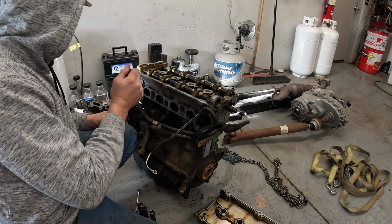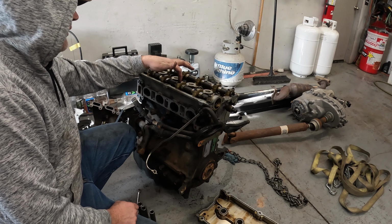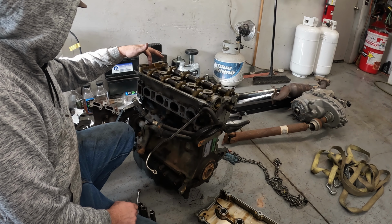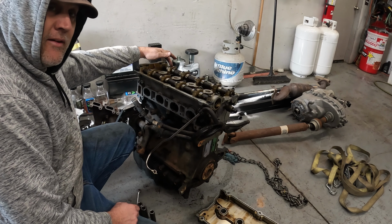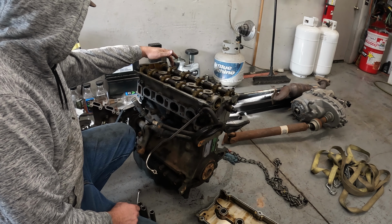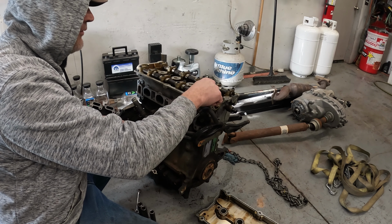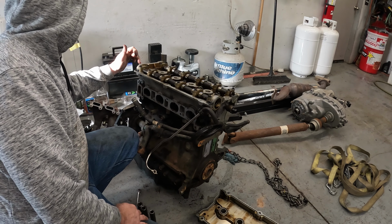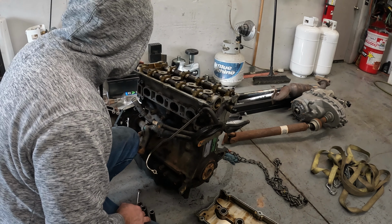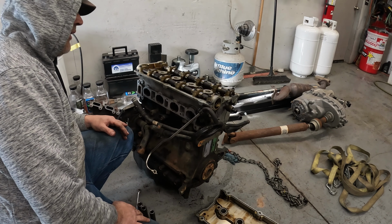Typically what you should do is you should have a punch, and this should be numbered 1, 2, 3, 4, and they should be marked. You could also put maybe an I for intake. You would also do the back the same here. You could put exhaust or rear or front or intake, depending on the punches that you have, because these are actually labeled front and with the arrows going that way. Same with this, L and R, L and F. So sometimes they will be labeled, sometimes they won't. It just depends if somebody took it apart to redo the head.